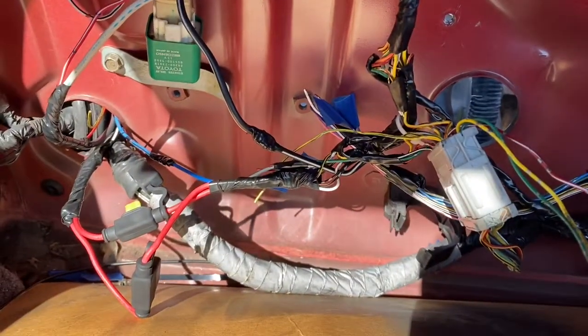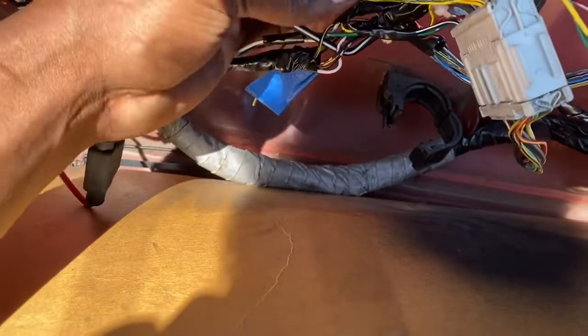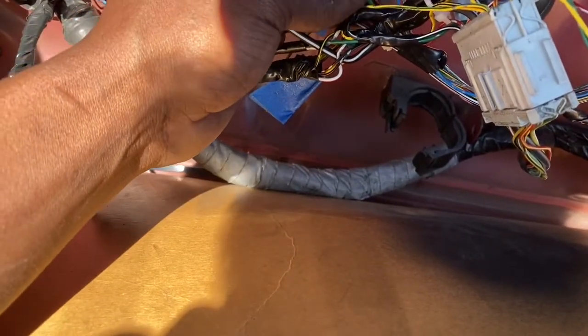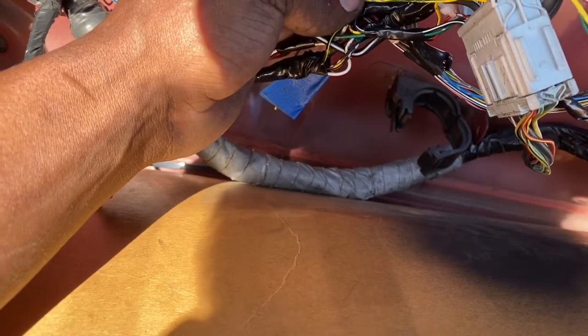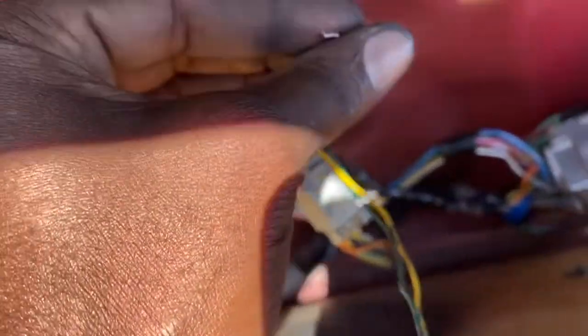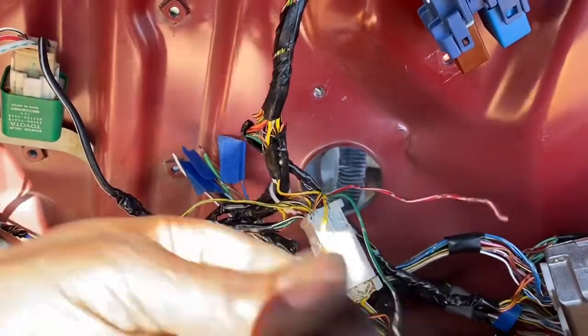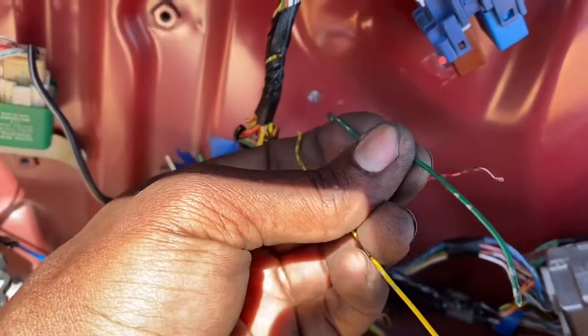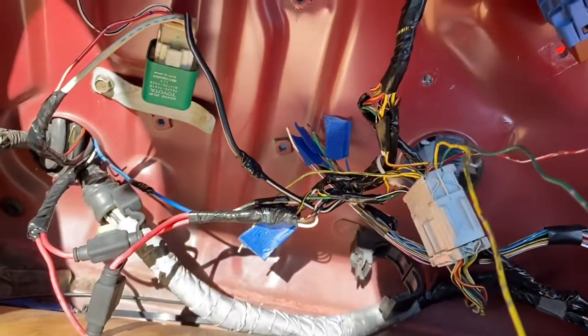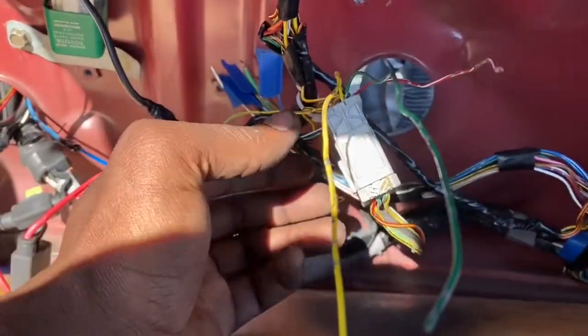Next video I'll be doing the fuel system, and then we'll be connecting our cluster — oil pressure, tach, speedometer, check engine light, and the communication link for battery and temperature. Some wires won't be used at all, like this red-white wire. The yellow one appears to be a communication wire — not used. One wire goes to a fan switch which has already been tapped, so I won't be doing any of that.